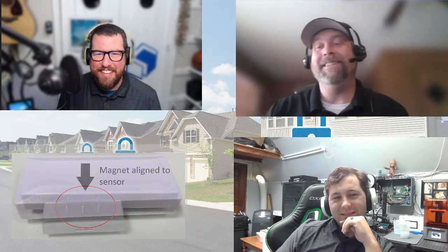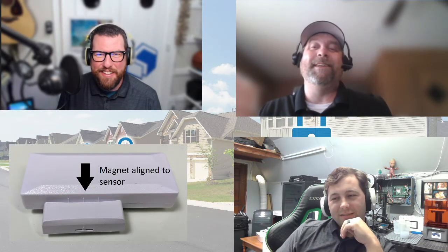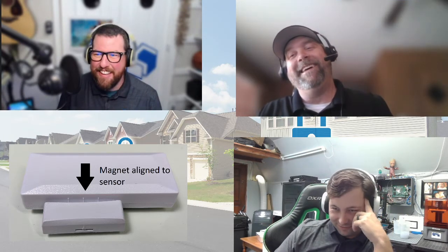Make sure you're lining that magnet up to the correct side of the sensor — don't put the sensor in backwards. There are little ridges on the sensor; make sure those ridges line up facing the magnet side. It's happened a few times where it's installed improperly and it just won't work. Alright guys, that's all we have time for today. If you're interested in more, please subscribe to our YouTube channel. Take care, gentlemen — thanks for joining!